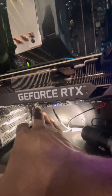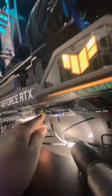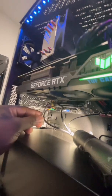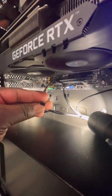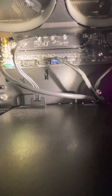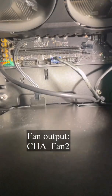I'm going to just pull on it — see, that came out. That's the quick connect. And you can see you have three pins: one, two, three. So let's look for another one. This motherboard here says CHA FAN 2.